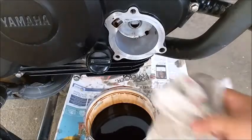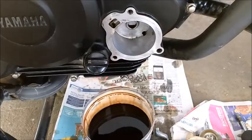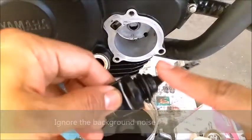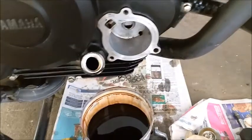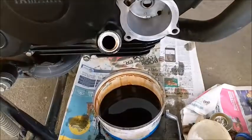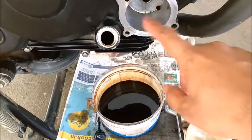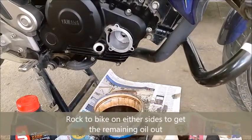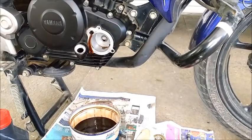There are some sharp edges inside this part — not honed properly — so take care not to hurt your fingers. I'm almost done. The last thing I'd like to do is remove the engine filling cap and clean this part up. You can still see oil dripping, so I'll let it sit for a while and let the oil drip as much as possible before filling up new oil.